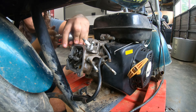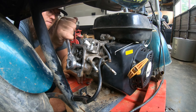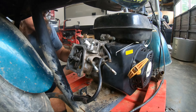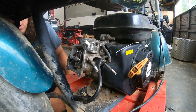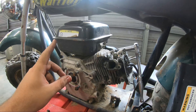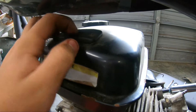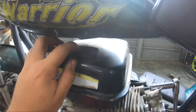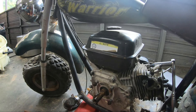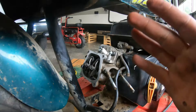That seems torqued enough. The GoPro is about to die so I'm going to do the other two head bolts. Just a quick side note while putting in the last two head bolts — remember when I looked into the tank there was like a float-looking thing? This thing's got a fuel gauge on it! When that's cleaned up, there's a little line that shows you how full it is. There's a fuel gauge on there — that's pretty cool. I was also able to just push these springs down and wiggle that on there, so I didn't have to worry about valve lash.